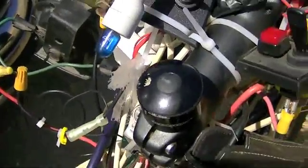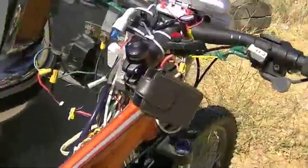The alternator has a lamp circuit, just like I mentioned. So what you need to do is wire up in series an incandescent light, which was easy for me to do since I didn't have any resistors or anything laying around. I just did that. And I could also tell when I'm not pedaling fast enough.